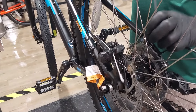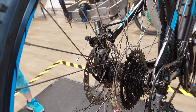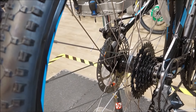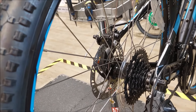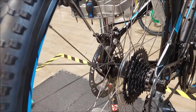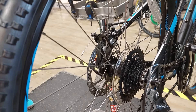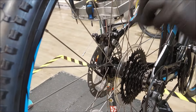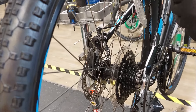This is what's known as a cam caliper. When I turn the cam, it actually moves in and out. I've got a pad here and a pad here on the static side, which forces the rotor into the other side — that's what grabs it. That's why disc brakes function so well: you've got a ton of surface area to work with.